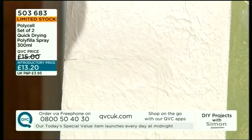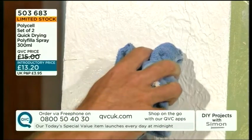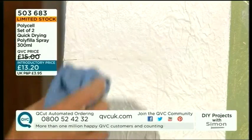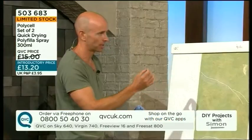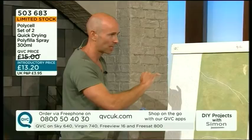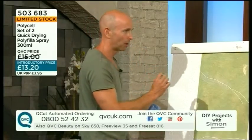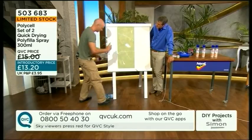I tried to get my head around how this works so well. The only way I can describe it: the particles in this filler, in this spray, are absolutely tiny. If you imagine a normal filler spray as something like semolina, this is talcum powder - the particles are very, very small. Glass bead technology. So the hairline cracks that you can never fill unless you gouge them out first - these will fill. Now this will only do small things; if you've got a huge great crack, the other type of fillers still have their place.